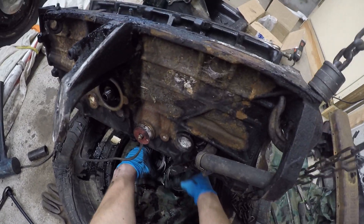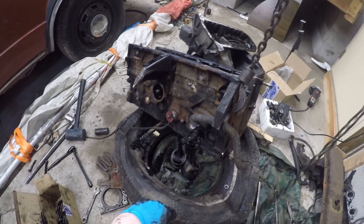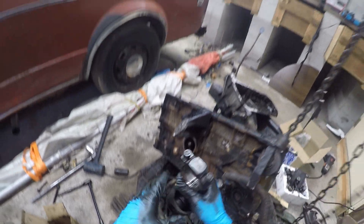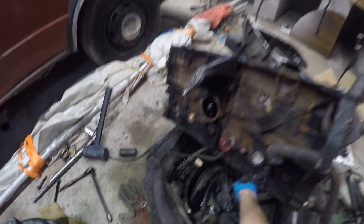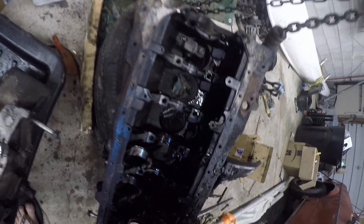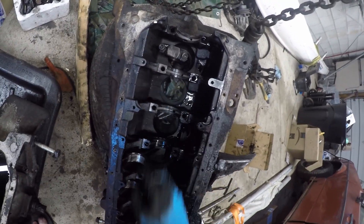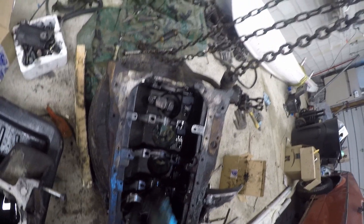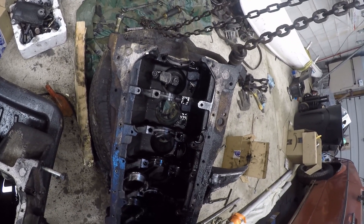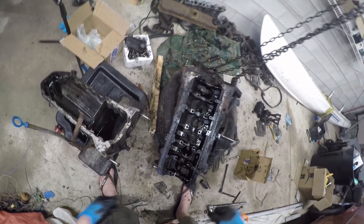So now I've got to pick up on it to try to get the two pistons I did remove out — it's not tall enough just yet. Ta-da — 4 and 5. I've seen a lot of forum posts with people talking about where they would add oil squirters when they turbo-convert these D24s, and right here on those flat castings — that's where the squirters should go. Anyhow, for the next video I'll be getting a real engine stand hopefully and pounding out the more stubborn of all these pistons. Stay tuned.